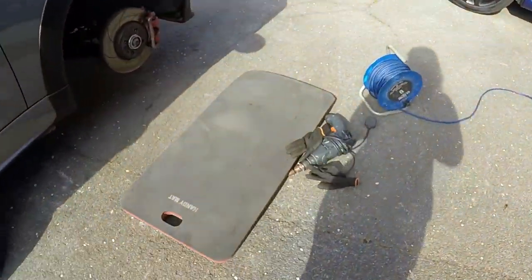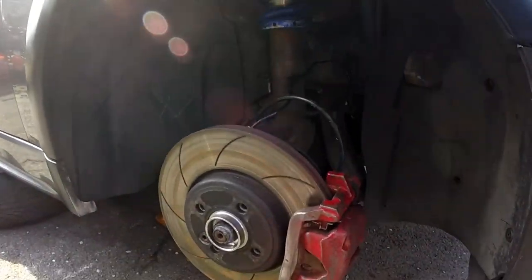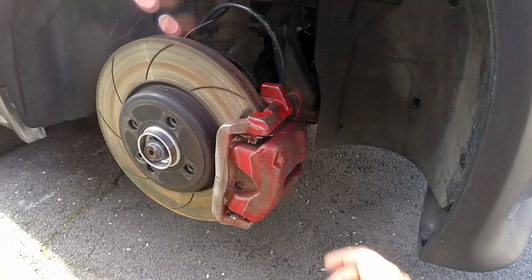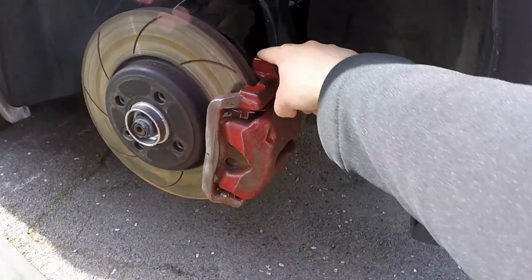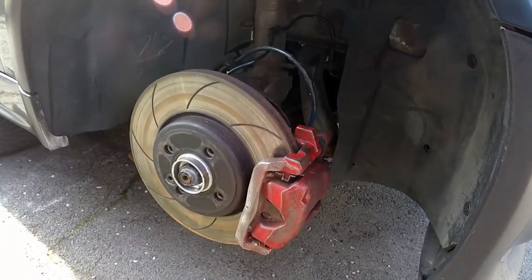So we're back again - it is day two and I'm going to wax all the underneath today because it didn't dry last night and it needs to be bone dry before I can put any wax oil on. Yesterday I actually managed to find a drill in the shed with a wire brush attachment, so I made a start on getting the paint off the calipers, which is a lot easier with a wire brush but still time consuming. And then I'm going to try and change the brake lines today - both front ones. That's today's plan.